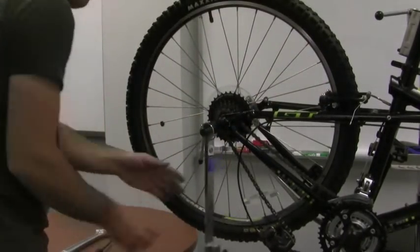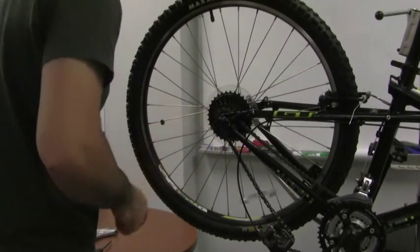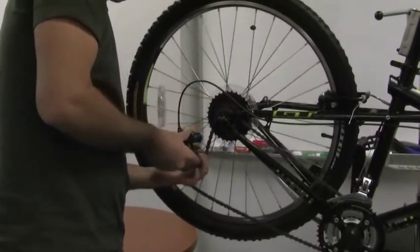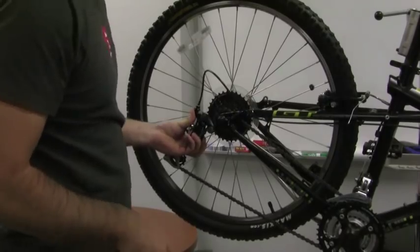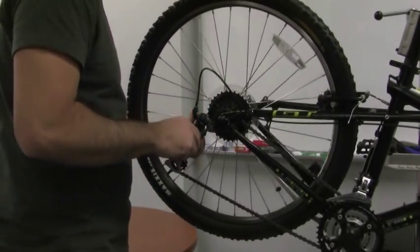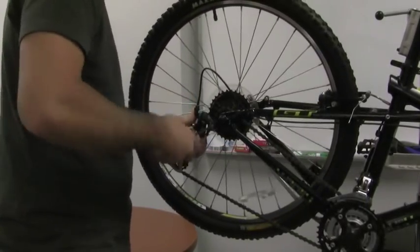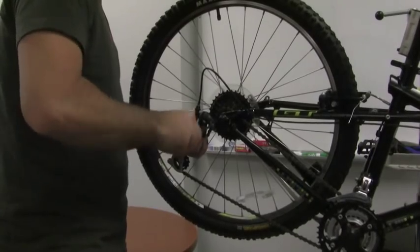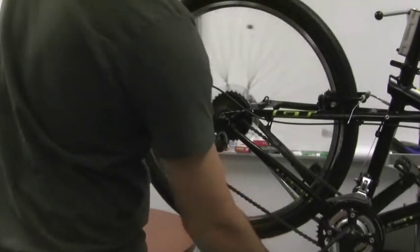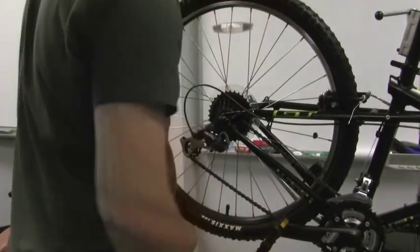When you're done, go ahead and remove the tool and reattach your derailleur. When reattaching, you'll have to work against the spring and get it high enough that the small screw here — called the B screw — is clearing the little tab on the derailleur hanger. Be careful with the threads again as it's pretty soft aluminum. Once done, get it nice and tight and check your shifting. You should find that your hard work setting your cable tension, limit screws, chain, and shifters has all paid off and you should be good to go.